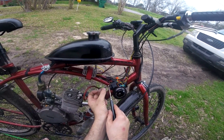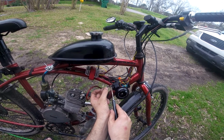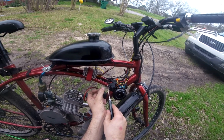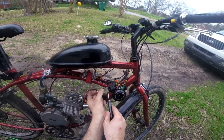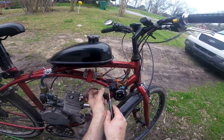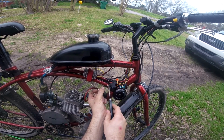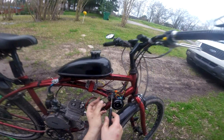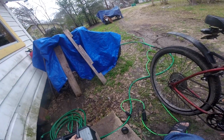I want to make sure that the solder on both ends of the wire is completely melted before we take away the heat. If you don't, you leave some of it that's still solid and some of it that's liquid. You get what's called a cold solder joint. Those are more susceptible to break under vibration or just moving the wire around.